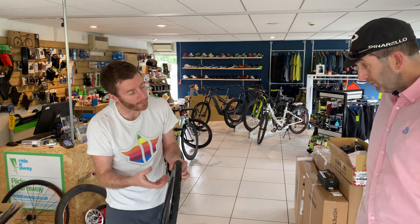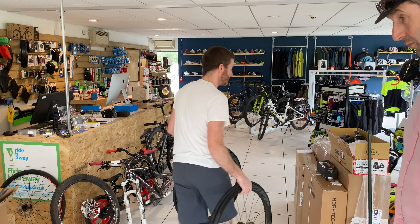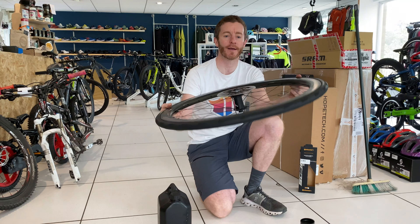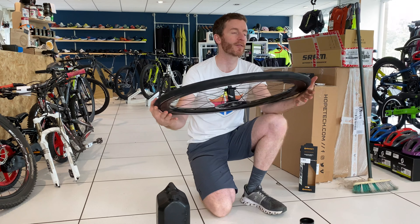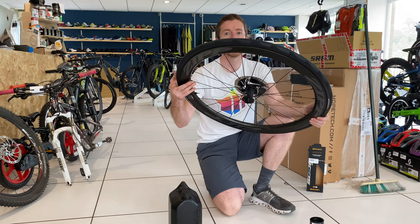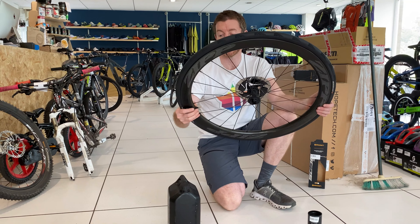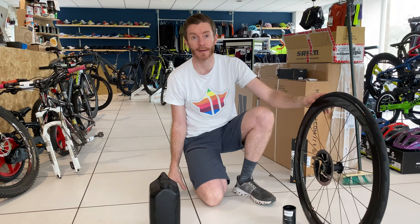The next phase is we'll pump them up without sealant. Wheels are up without any sealant, and we know we've got a good quality seal because we can't hear it seeping or leaking anywhere. So we're onto a good thing straight away. If it is leaking quite badly at this stage, then you know there's an issue — whether it be rim tape that needs replacing, or the valve not seated right, or anything like that. So before you get to the messy bit, make sure you're at the point where it's actually solid.